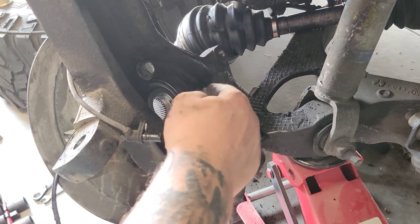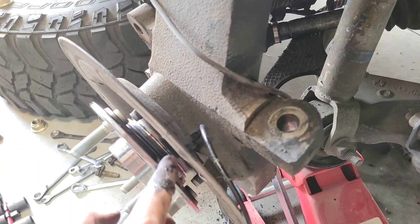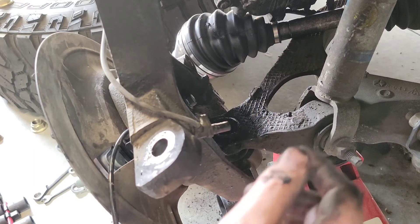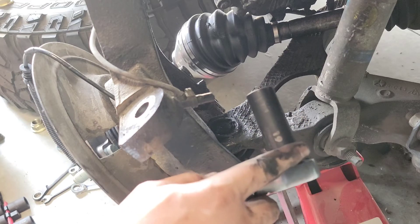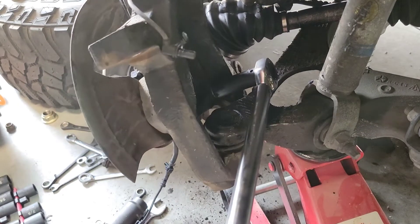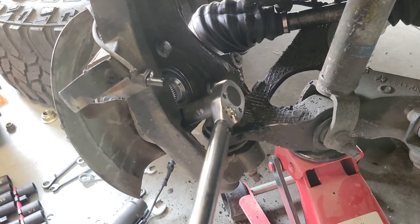Now I've got everything put together. The three hub bolts are torqued down to 140 foot-pounds — make sure that's foot-pounds, not inch-pounds. When you put the hub on, don't forget the dust plate: there's a slot that needs to line up with your ABS wheel sensor. There's also a groove in the spindle that aligns the wheel bearing with that ABS wire. When torquing, you can use an extension, but don't use a knuckle — you must maintain a 90-degree angle or you'll change the effective torque spec.